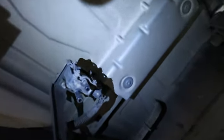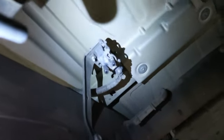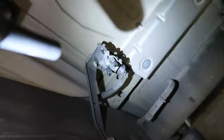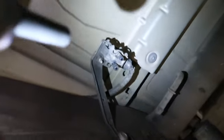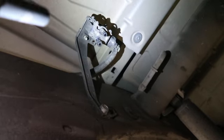So you can see this little sensor here, right? It has 2 hoses on it. Those 2 hoses are right there. The rubber ones that come out over there connect to these. Now, you need to leave this sensor plugged in, but take both the hoses off. It'll simulate that the exhaust is free flowing and everything is good, and you'll get a good reading back. So you won't have any reduced power mode or anything like that. So make sure to leave that plugged in.